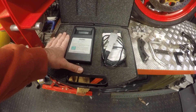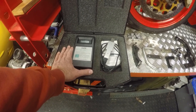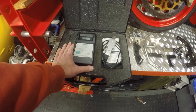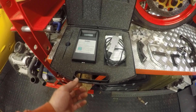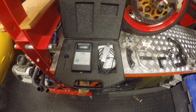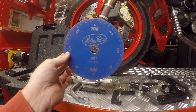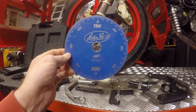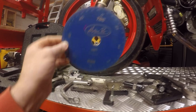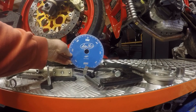You've got the Clavis belt tension meter, which is the ultrasonic tool. There is a tension tool Ducati used to use years ago but I don't know anybody manufacturing that anymore and I haven't seen one for sale in a long time — these crop up occasionally. If you can't afford one or can't find one, a really good microphone and guitar tuning software can get you past that. And one tool I forgot to mention under standard tools: a timing wheel. This is a four-stroke timing wheel broken up into 90-degree quadrants, which makes it a lot easier to understand what you're doing. It's designed to fit on the back of the engine turning tool.